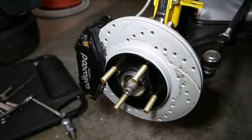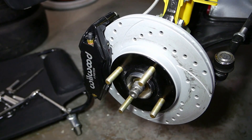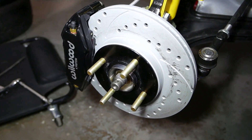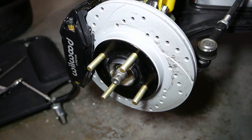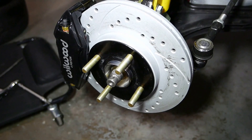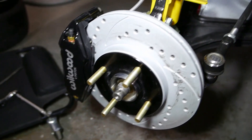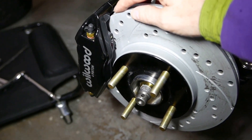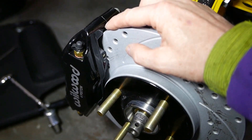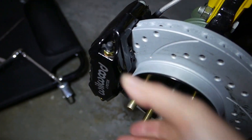Just a quick talk about the Tech 53 brakes and the interference I was trying to chase down. Basically what it came down to was the caliper — I wasn't careful when I mounted the caliper to leave a full gap. This gap here between the top of the rotor and the inside of the caliper has some variability when you mount the caliper; you can move it 20 or 30 thou.